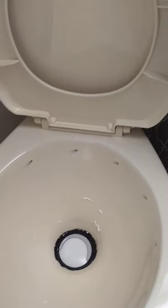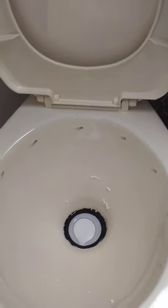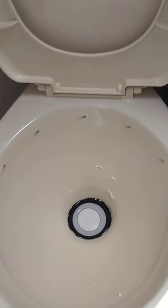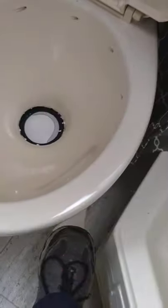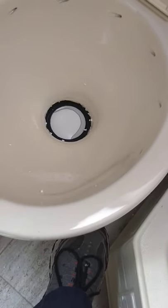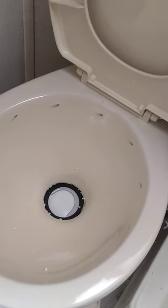Let's say you're staying at the same campsite and your tanks are full — you dump your black tank, come back in here and repeat the procedure, because the chemical has been washed out and there's no water in it. Put some water in with the chemical, a gallon or two, and you're all set. When flushing, it'll only fill up to a certain level. To add more water before you use it, you can push the pedal without the trap opening — it still activates the water valve so you can fill the toilet bowl as full as you want before each use.